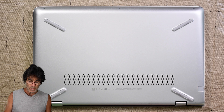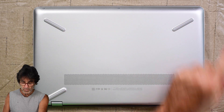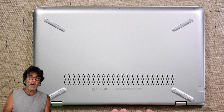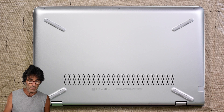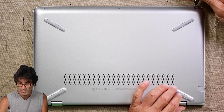Before we get started, we have a pretty easy job ahead of us. It's just these three screws — one, two, three — and then there's one screw each underneath these rubber pads, so a total of five screws. To get this back popped open I like to use a little kit like this, kind of like a phone opening kit. It comes with these little plastic tools that help to pry everything open without scratching it. I'll post a link below to those tools.